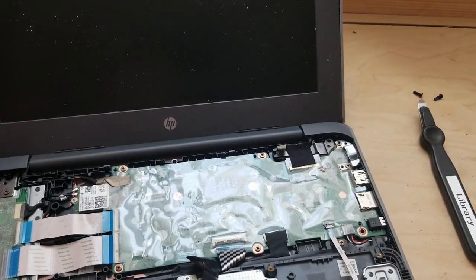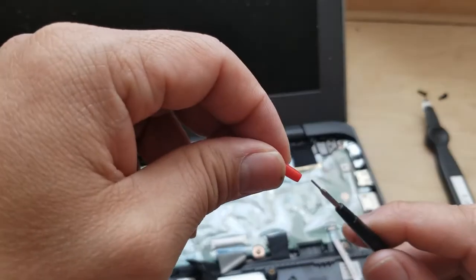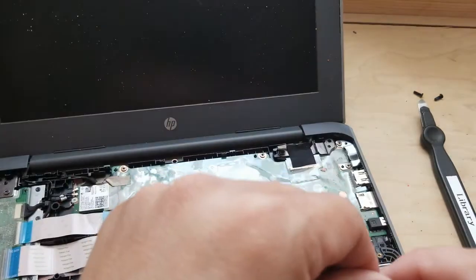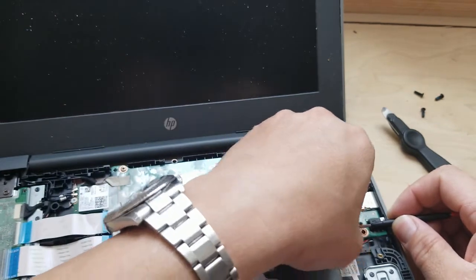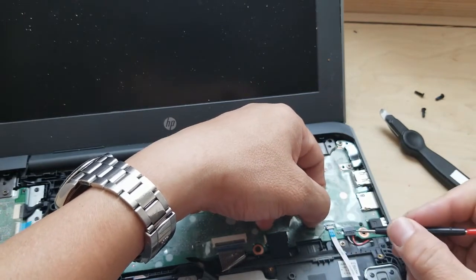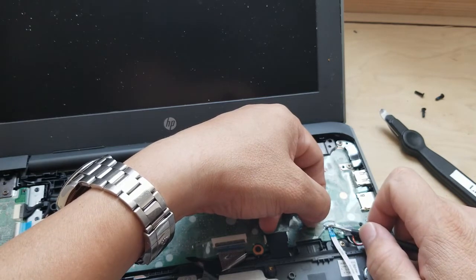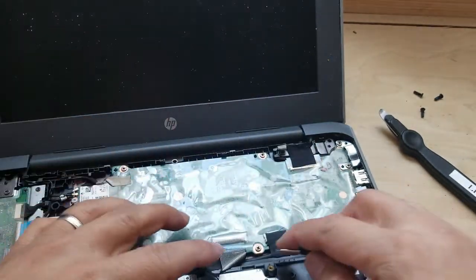Leave it like that. Here's how you remove the cables — I have a small flat double-fork piece that is helpful. There are connections on both sides. Start with one side and move the tape out slowly — don't rip it off because you'll need it. If you look carefully, there's a plastic clip. You need to pop that plastic clip up first. Once it's popped up, you can pull the cable out.